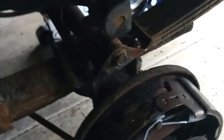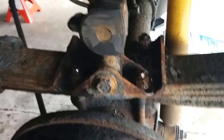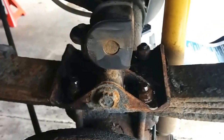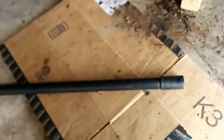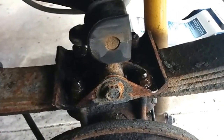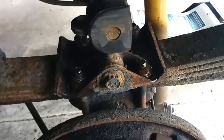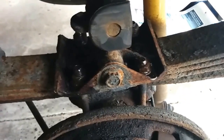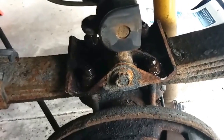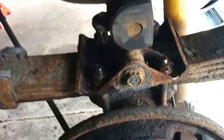So I moved over to the perch, to the spring plate. Those were pretty bad — they didn't want to start at all. The impact got like one of them started but the rest required a lot of just horsepower. Same thing: breaker bar, shortest extender, mostly a deep well 18 millimeter socket. I kept oiling them with Aero-Kroil and heating them up a little bit. They're moving now — I think the impact has them all moving now, so when I'm ready I can take those off.